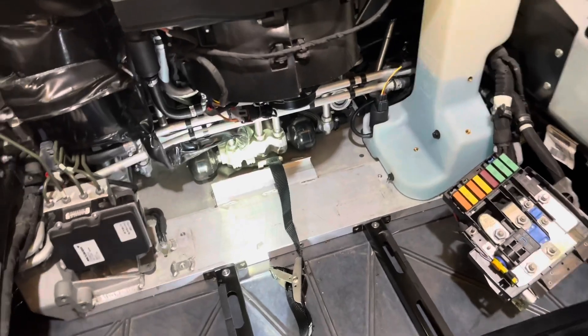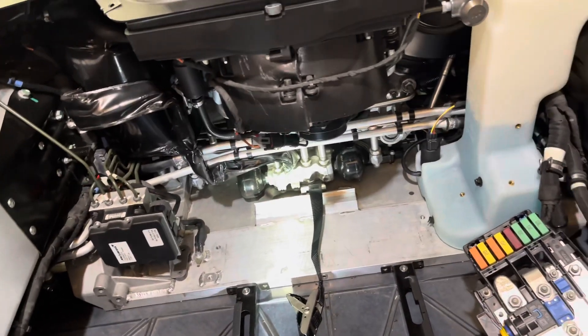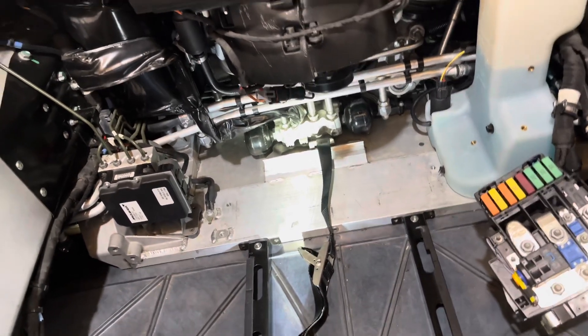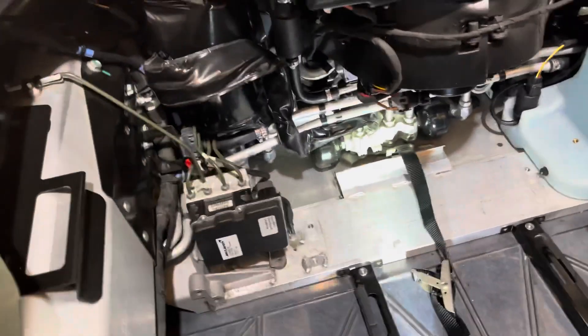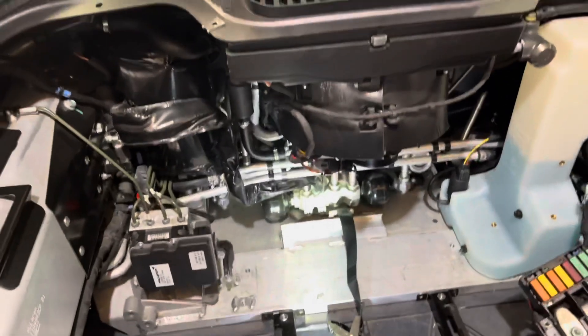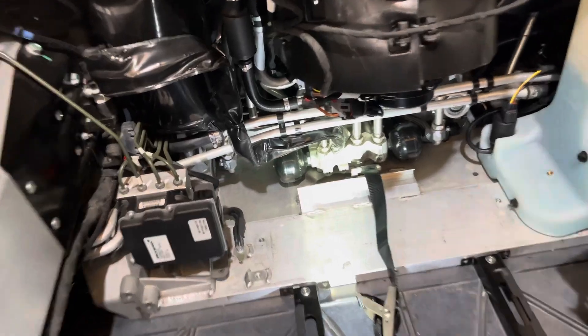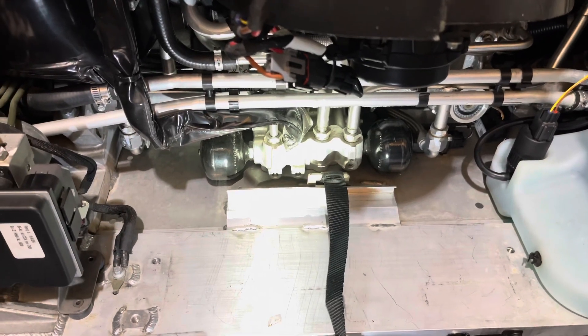After that, put the battery back in, start the car up, and rotate the steering wheel lock to lock — going left side, right side, lock to lock 10 times — to vent any air out of the system. It is a sealed system, but like any other power steering system it does self-bleed. Power steering fluid is shared with the suspension since this is a complete hydraulic system.